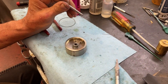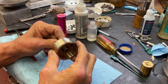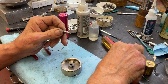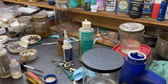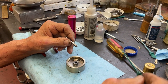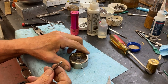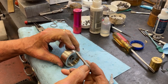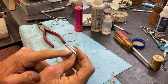First thing we do - because this flywheel rides on the shaft and it moves just a little bit, this little bit of movement will cause wear - so we're just gonna do a wee bit coat. You'll never oil this thing. A wee bit of STP, and we're only gonna put it right there. That's all it needs. So this shaft, the point end goes this way where the groove is because the governor drive gear hooks on to this part.